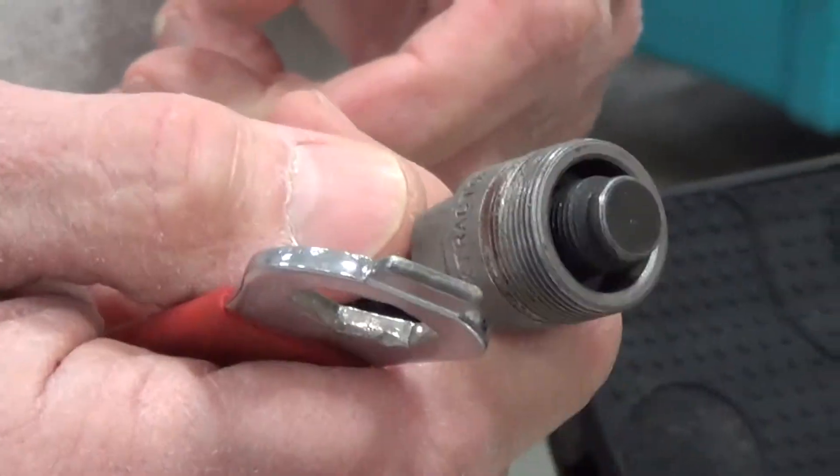You should also remove the belt first before doing this. You cannot pull this crank off the bottom bracket — the cross piece that goes through there — without the proper tool. You take this tool, put it in here; every one of these has the same thread, so you screw this part into the crank.